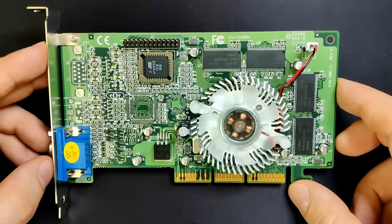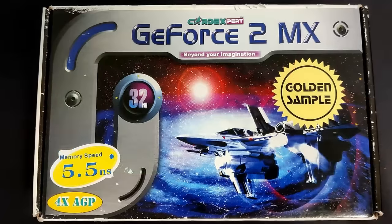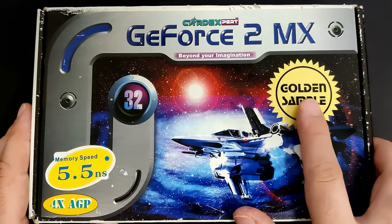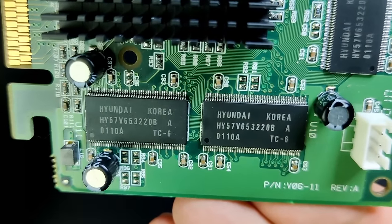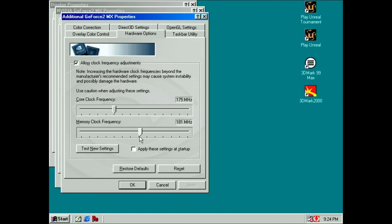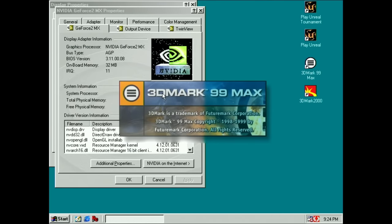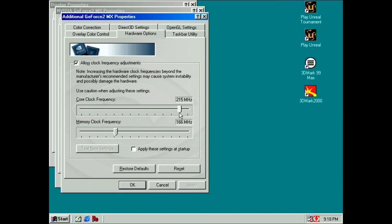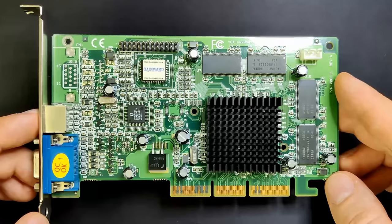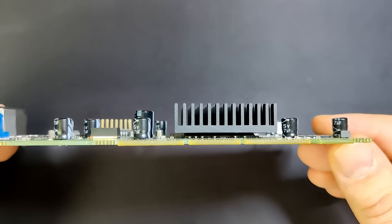Before finishing, I want to share one more oddity about my GeForce 2MX. This is supposed to be a golden sample, which, as far as I could find out, was just equipped with faster 5.5 ns memory chips. My second GeForce 2MX has 6 ns memory and did not receive the golden sample badge. The weird thing is that I cannot overclock the memory to the frequencies it is specified for — 5.5 ns should allow for 183 MHz, but as soon as I set it close to that frequency, graphic errors appear on screen. Interestingly, I can set the core frequency all the way to 220 MHz without issues, and the GeForce 2MX with the slower-marked memory can overclock with both sliders for core and memory to the max without any problems.